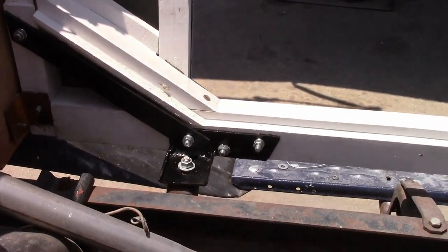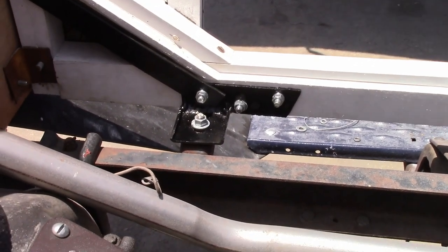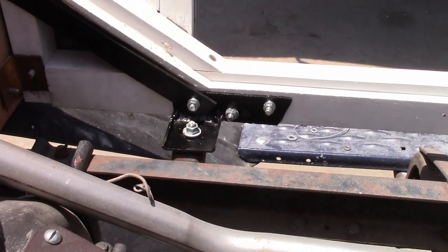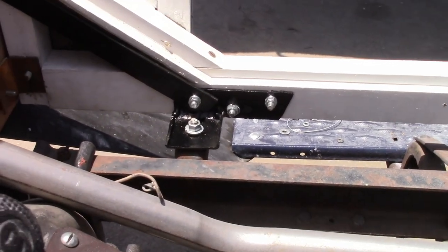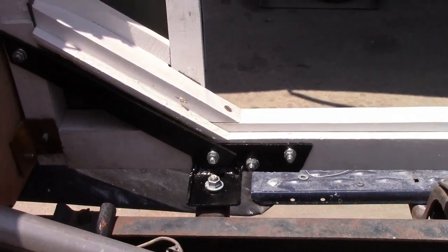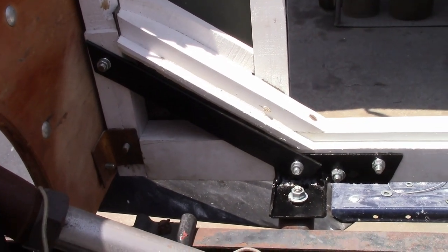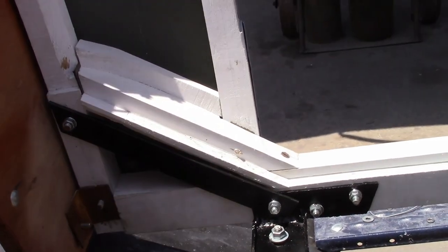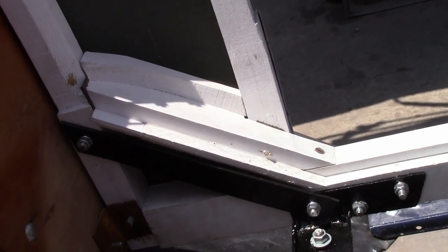On the right side, I made the mounting bracket for the frame. It's held onto the sill with three screws like the original, only I offset it so it's holding the sill a little further back. I also added a steel brace to go between that and the post to make it a little stronger. I also have the piece that holds the floorboards on attached.